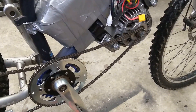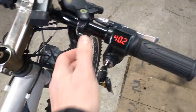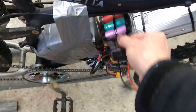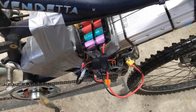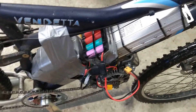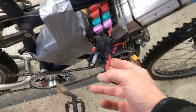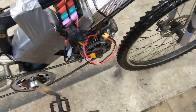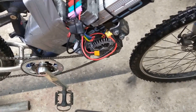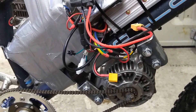Anyway, that's for another video. I was thinking maybe of just putting 4 or 6 batteries down here to replace this pack. These are old laptop batteries so they won't last very long and you can't get much power out of them — and there's a lot of them so they're quite heavy. If I could go with just 4 or 6 standard lithium ion batteries, that should be enough to give me the voltage needed to excite the coils and give me the magnetism in the motor. That's the plan anyway. I might go with a buck converter but I'm struggling to find one suitable for the job.